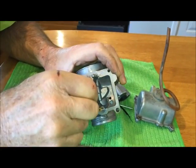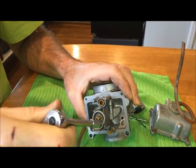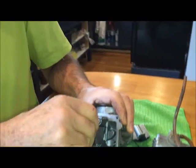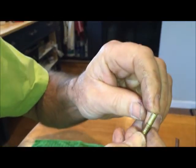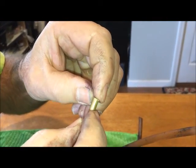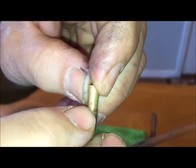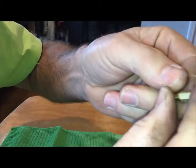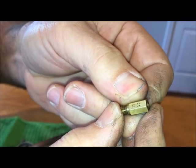Your main jet is a six-millimeter — you'll need a wrench for that. These numbers are stamped; sometimes you've got to use a magnifying glass, particularly if they've been roughed up. On the pilot jets, you've got a little marking and then it says 55 — that's how they're going to be stamped. On the main jets, turn them sideways and you'll be able to see the number stamped in there. This one is a 162, and that's because of my elevation issue. I normally run a 168 at sea level.